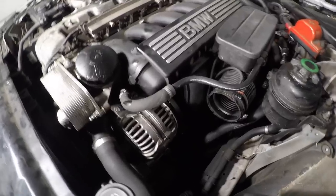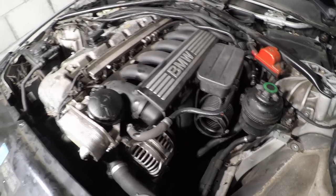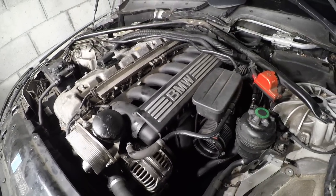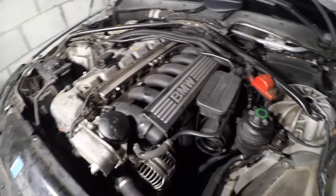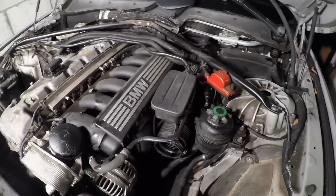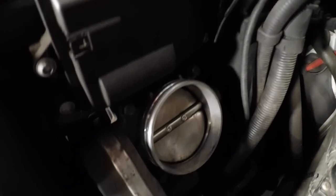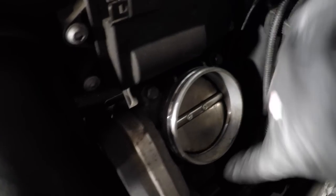There's also a purge solenoid connector — take that off. There's a bracket where the electrical harness runs. I wouldn't advise trying to pull it off; instead release the two Torx bolts and let it hang in the engine bay, because most of the time the clips break and you don't want that swinging around in the engine bay, especially with all the electrics on this car. As you can see down here, those are the 10mm bolts that sit around the throttle body housing. I've disconnected the connector.